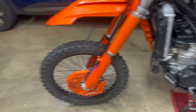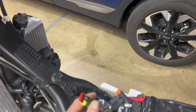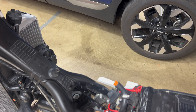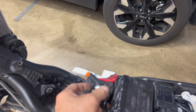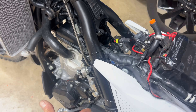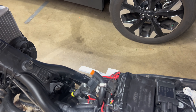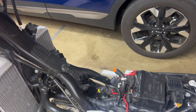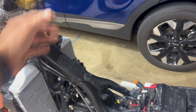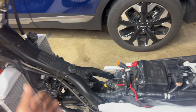That screw is longer, so make note of that. I take this connector off, and when I go to put it back on I add some dielectric grease. I've also changed the clamp so I take the hose off the tank instead of from down below, because it's just so much easier. There are two tabs here holding the plastic on — push it out of the way — then four bolts on the front and your screw here to remove the tank.